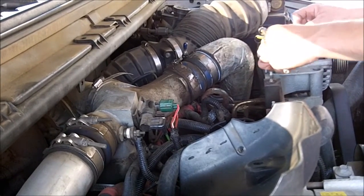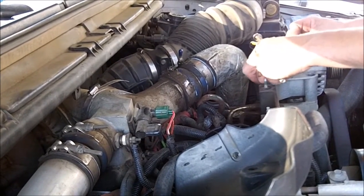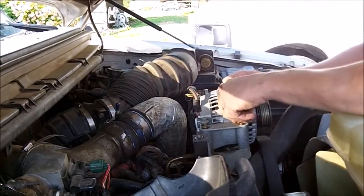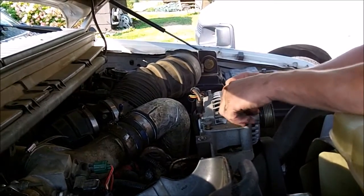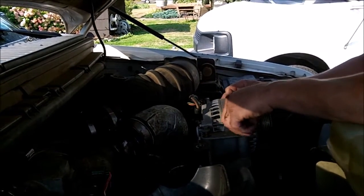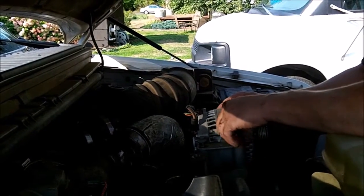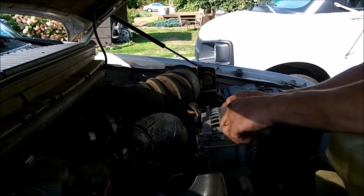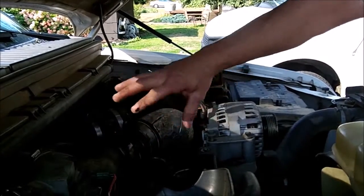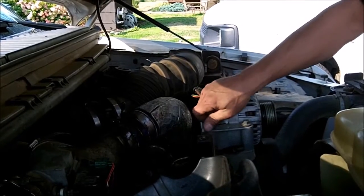I like to have acetone in a little squirt bottle, and 3-in-1 on the top of my toolbox. Acetone seems to be about the most fun thing to use. It cleans parts real well, and you can use it on your carburetor and clean carburetor parts, your jets, and it just works really well on all kinds of things when you have it apart, disassembled. I don't know what acetone does if you just spray it into an existing operation. I don't know if it's any good for your engine.